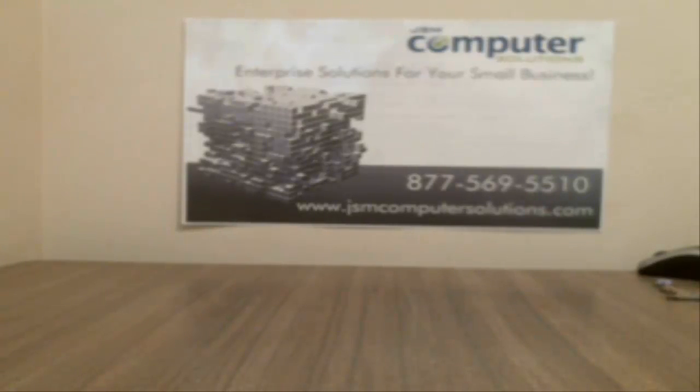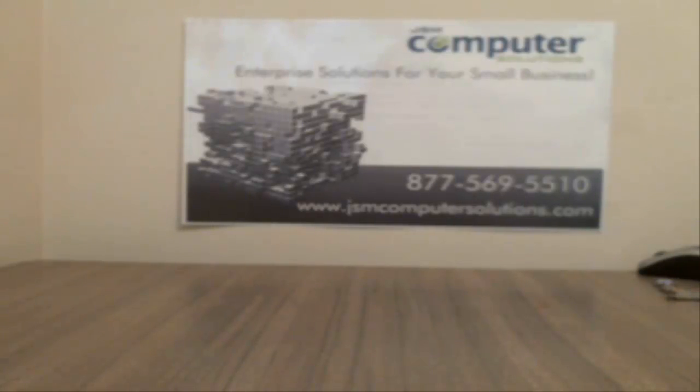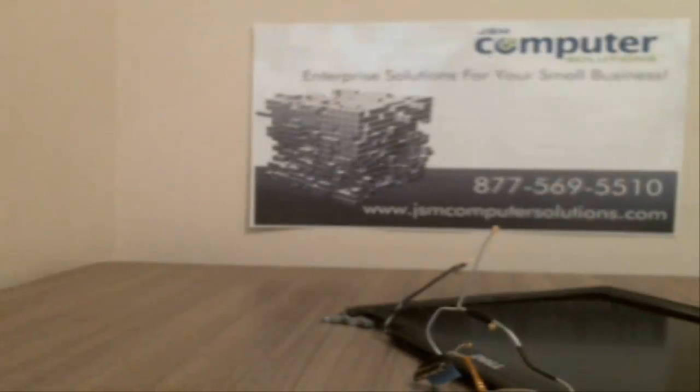The last part is going to be the LCD. What we've got is four rubber spots at the top and two at the bottom — we're going to pull those off, and once we pull those off there'll be screws underneath. We'll take those screws out.